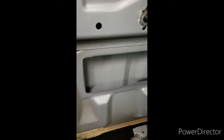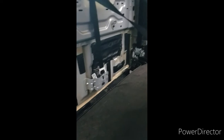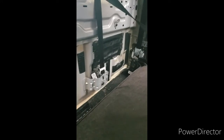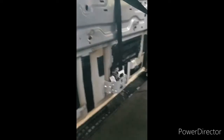Sound deadening applied. Cover the big holes, hit the highs, couple of the lows. Sound deadening — you don't really need to cover the entire panel. You just have to get the center of it so it doesn't tin-can and go doing doing doing doing. But really these high ones — the wood's going to rest on it, and that'll keep the wood from squeaking.